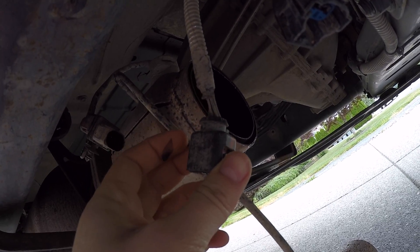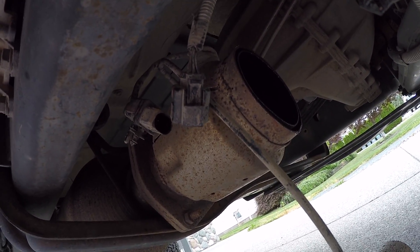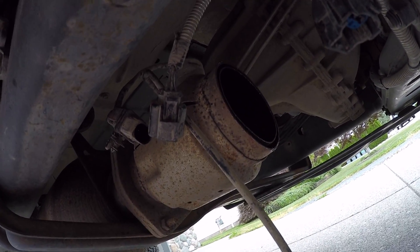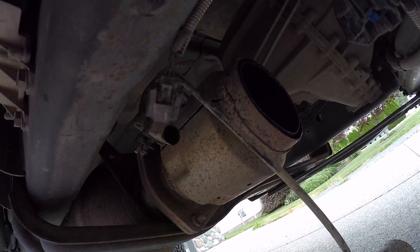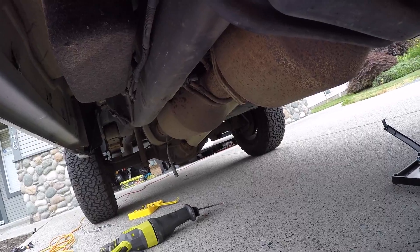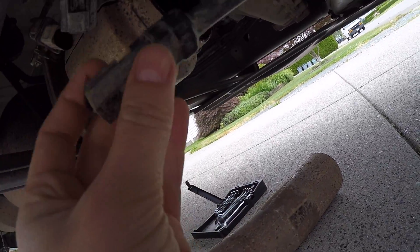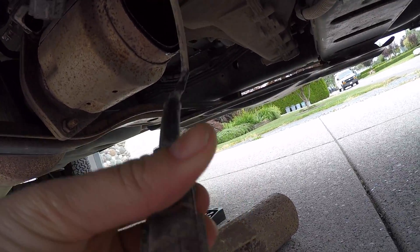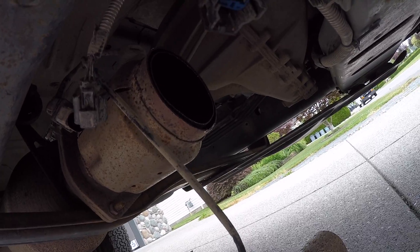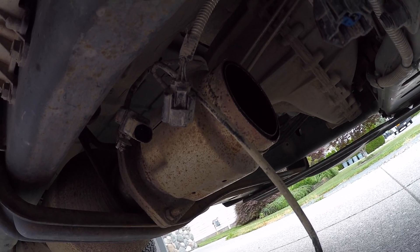You want to disconnect all of these cables which you're going to find along the side. These are just sensors for the exhaust. Disconnect them so that when you take the exhaust out, these cables don't come with them and wreck that. There's cables here and you can see the one loose down there. Basically go around and find the cables — they're pretty easy. There's just a little snap on one side; you pull on that little tab and it should slide right out. It is pretty dirty so it may stick, so just wiggle it around a little bit to slide it out.